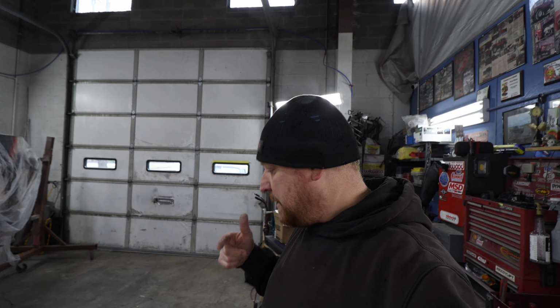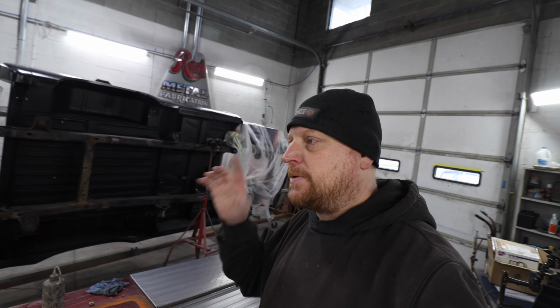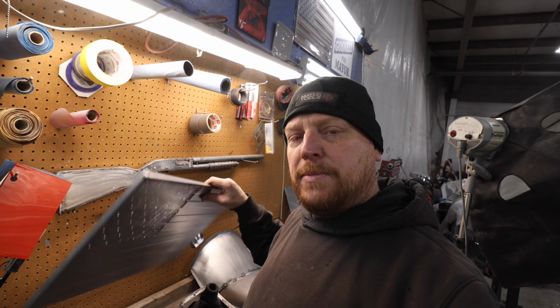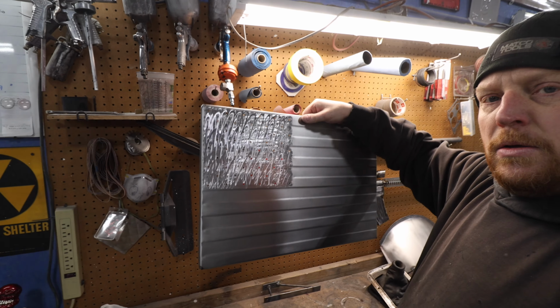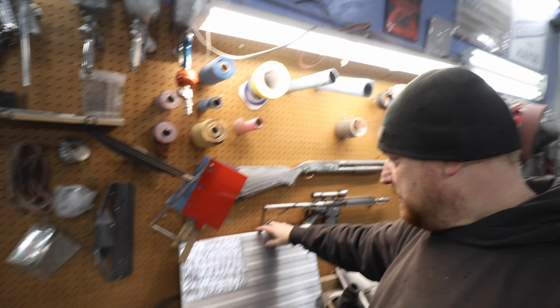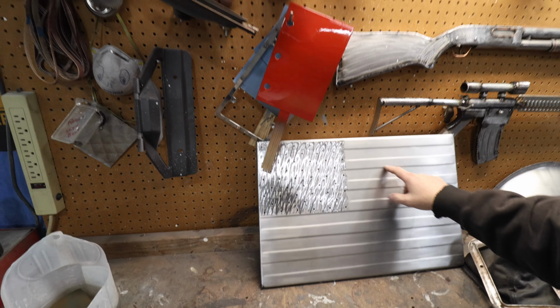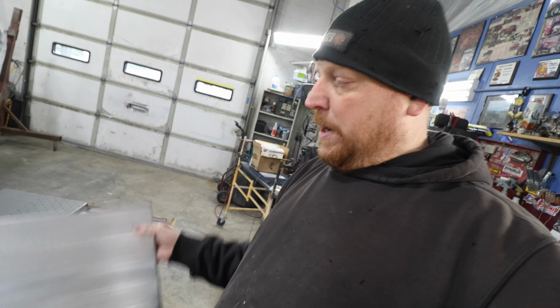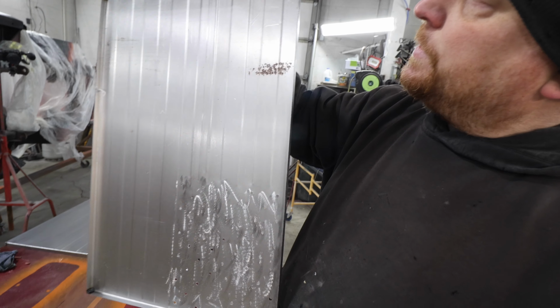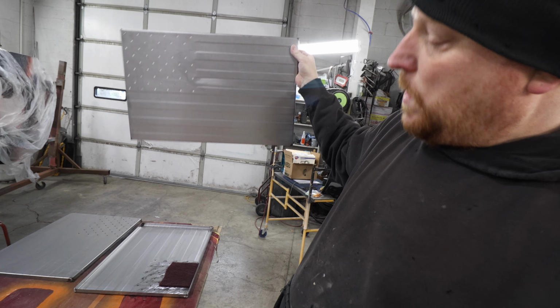Alright, welcome back. So last week when we were messing around with some of this other stuff, John, J-Dub, went home and cut some metal, took it home and drew out some flags with a Sharpie, basically had lines here, and then brought it back in and bead rolled them out, and then went and broke the back sides at 90 degrees, about a half inch deep, and then welded some washers so we could mount it up on the wall.